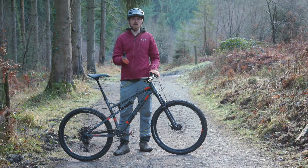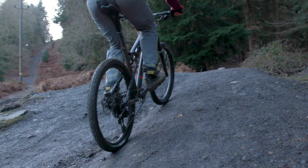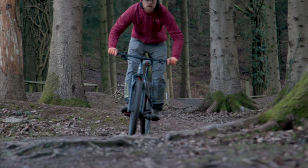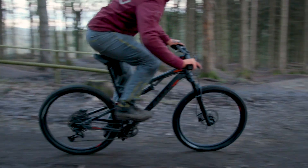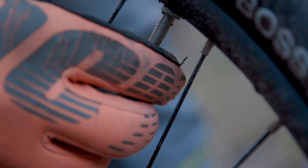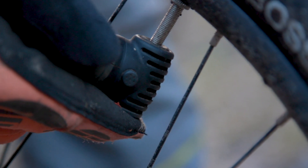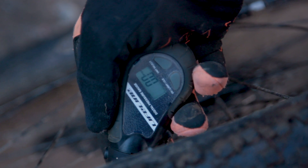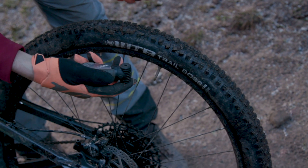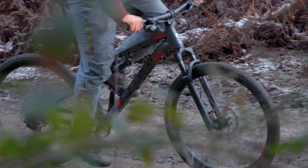Step number six is to check your tyre pressure. What tyre pressure you want will depend on a whole range of factors, but generally speaking for mountain bikes somewhere in the 20 to 30 psi range is about right. You see a lot of people with a lot more than that, but there's really no reason to go above 30 psi on a mountain bike these days. To check your tyre pressure the best thing to have is a digital tyre pressure gauge — these cost about 10 pounds and give a really accurate, consistent, precise measurement — but if you don't have one, the gauge on a track pump will be absolutely fine for most people.